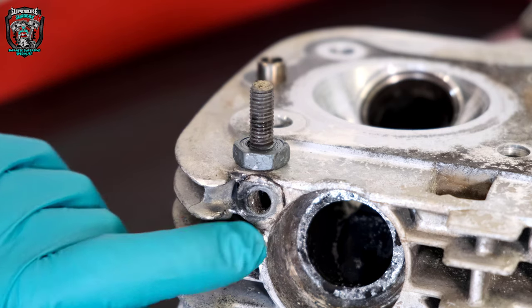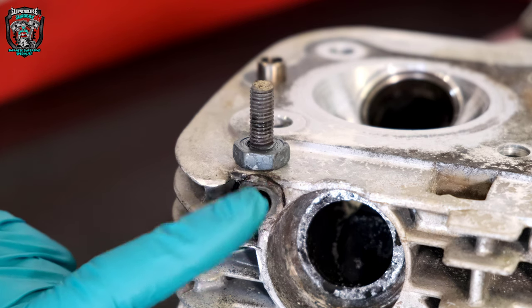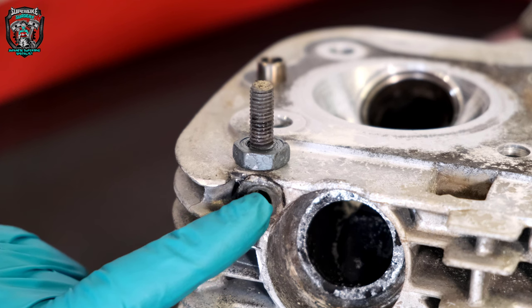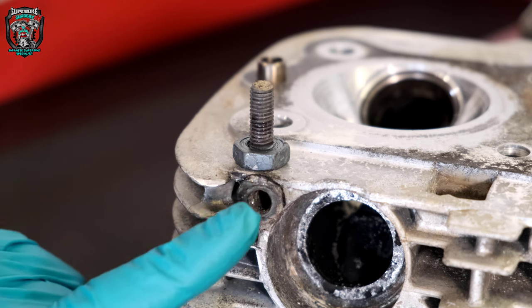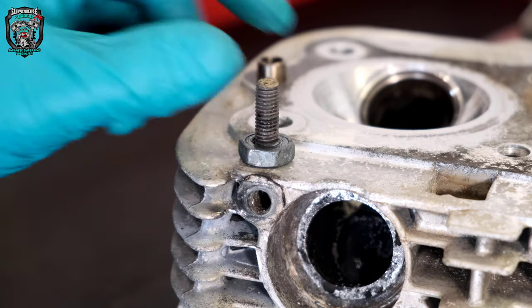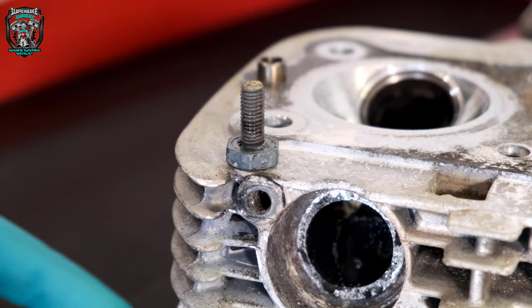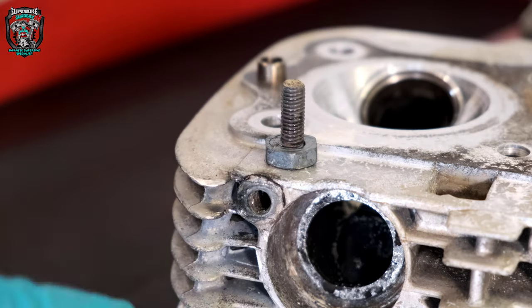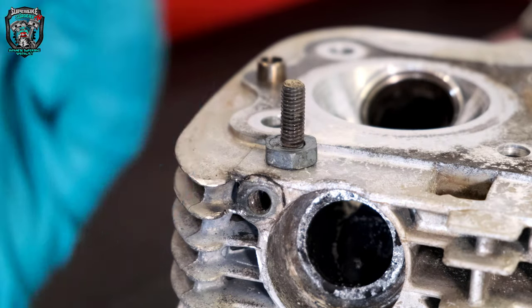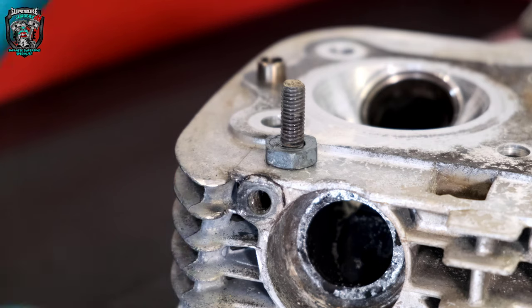That's my take on getting an exhaust stud out. I should mention what you do when the stud is snapped off flush with the head: you very carefully build some weld up on the end of the stud, grind it flat so it's nice and clean, build the weld up so you've got a little nipple on the top, drop the nut over, and basically do what I just did. And that works just as well. When welding I've got gravity on my side — I turn the cylinder head up so the weld pool sinks down into the nut. Obviously if the engine's in the bike and the head's on, you're welding upside down at an angle. It's doable but you need to be able to weld, otherwise it would all go horribly wrong. It's perfectly doable if you know what you're doing.